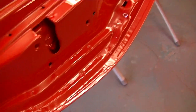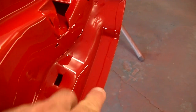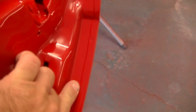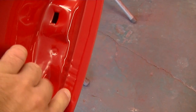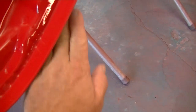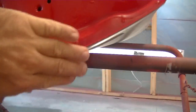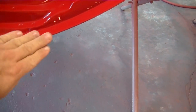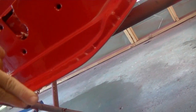As we can see here, there's a lip right there. We're going to tape on this side of that lip right along it to leave that edge — that tape edge right there. And we're going to paint this outside door skin here. We're going to shoot underneath and paint all the way up into here too. So this edge here is going to be really nice.